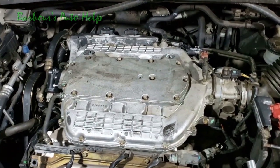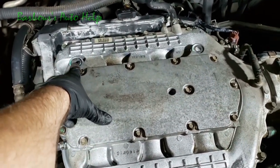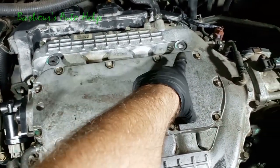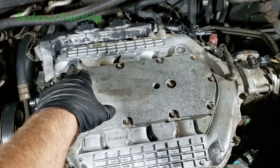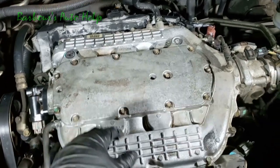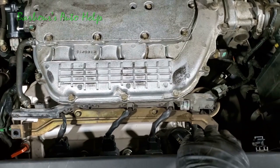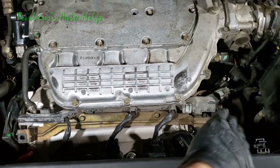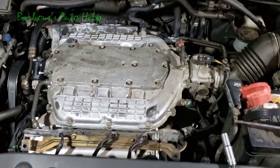And that's pretty easy to do. You just pop it right back down. You got these two rivets here, grommets. I'm missing one on the other side there. The engine cover goes back on. The little teats push down into the grommets there. And then, of course, you got your screws in the front here that you push in and give a 90-degree turn on each side there. And after that, guys, you're home free.